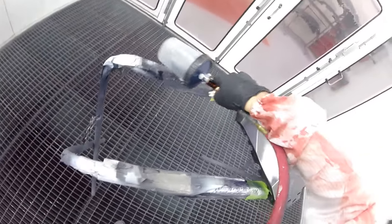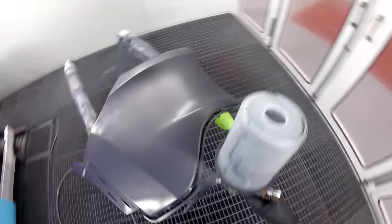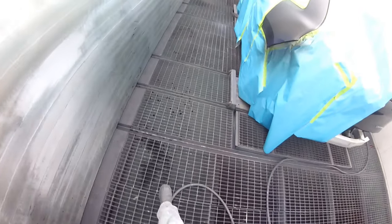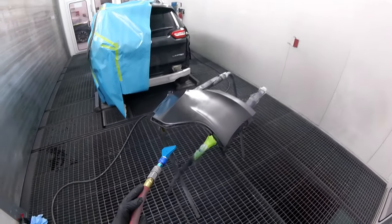By keeping the repair small, you're going to get rid of sand piling — you'll have a lot less sand piling, especially with high metallic colors like this one. I put two coats: one nice and light coat, followed by a heavy coat, just to get some coverage on there.